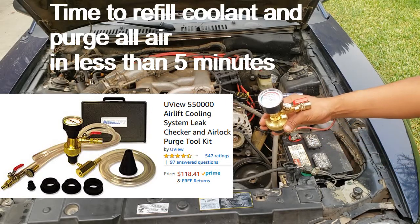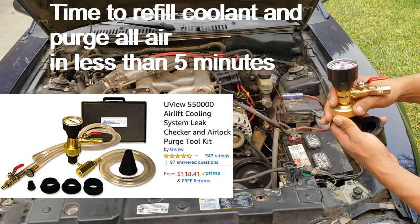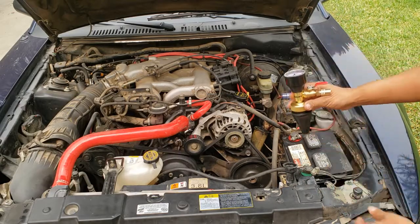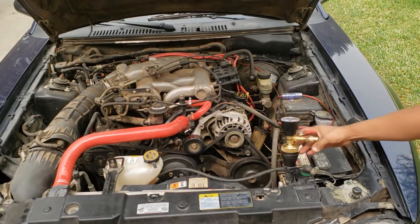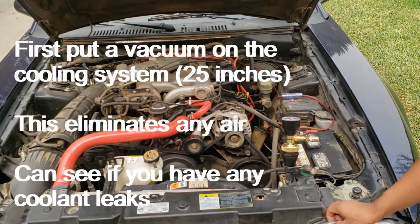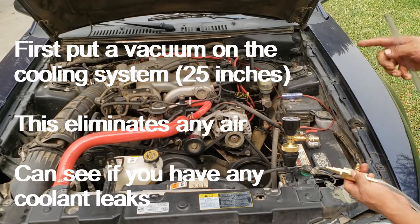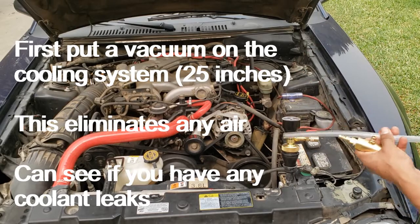Here's the tool — the 55 Quad Zero. Don't grab it by the gauge, otherwise you can break it. For the Mustang, the cone adapter works perfectly. Just put it in there snug, even though it's a little bit flimsy. Attach a nipple to this hose. And since my radiator is half full, it's going to suck out some coolant, so I have a bucket handy.